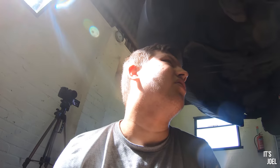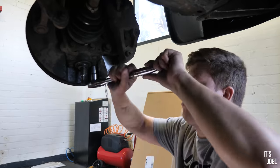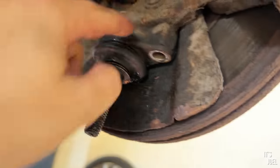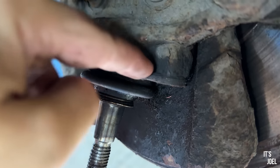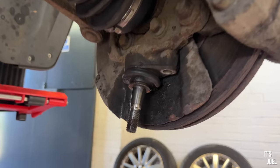So let's try and do the ball joint now, then I might look at the sway bar. The ball joint wasn't a failure but it looks quite good - I think we'll try and change it anyway. I've got the two 14mm bolts out of the ball joint, but the tricky bit is it's completely sealed. There are a couple of little notches there, so I reckon I can get a bit of metal and hammer it down on both sides to set it free. We're making progress - this is really good.